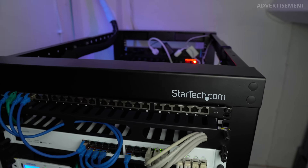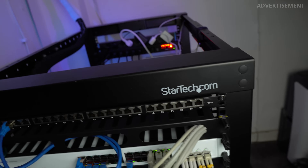That's basically how you end up with a chaotic setup as you add more and more devices to your server rack — especially when you change things often and experiment a lot, it just starts getting ugly. There's nothing you can really do about it because you need to connect the devices. So I knew I had to change this. I decided to add more ethernet cables to certain rooms and attach them to the patch panel, having more ports on the server rack available for connecting devices. This allowed me to move some of the devices I had placed inside the server rack before, like the access points and smart home bridges, and just place them somewhere else — greatly improving the organization and providing more flexibility.